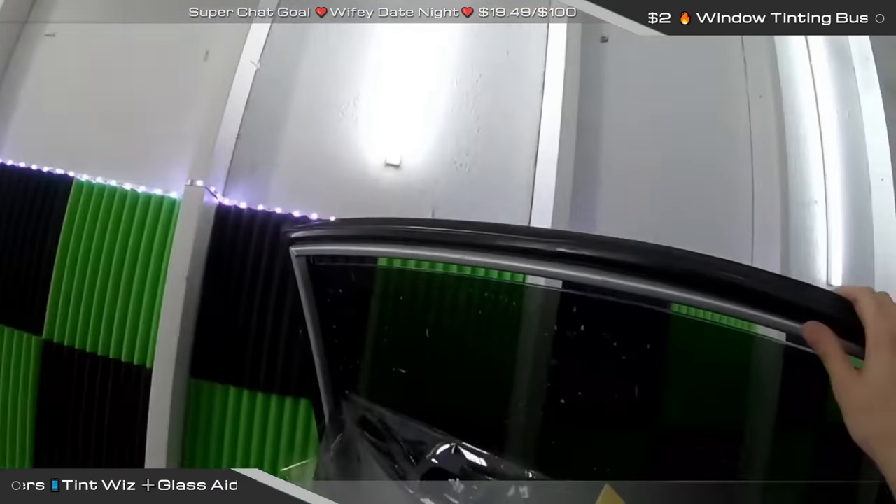On this back glass we have a really high brake light that doesn't give me a lot of space. I'm going to see if a bulldozer squeegee fits in between it — it should be fine. It fits between most except like the Chrysler 300 brake light from around 2009. On this one, because it's a little older, we're scrubbing it down. I highly recommend everybody pick up one of these scrubbers — you can find them on a lot of tool sites and they grip the scrub pads so you can get everything down.